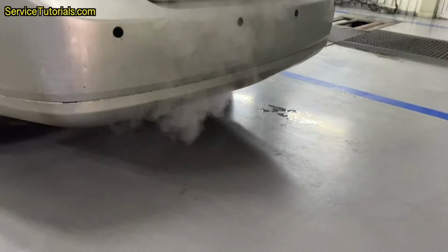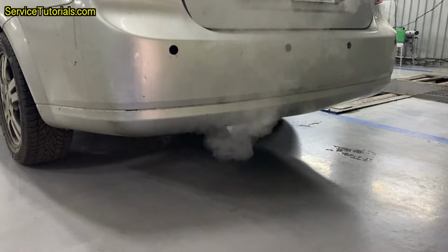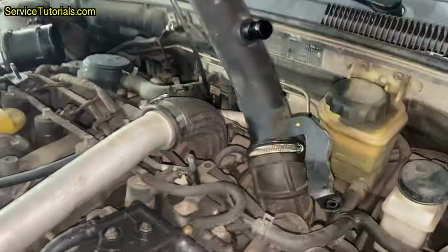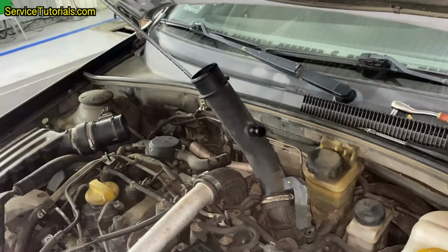You can already see that the car has started to take the white smoke out from the exhaust pipe. This means that the DPF cleaner has started to work, vaporizing all the hydrocarbons and removing the ash from the particle filter. The GerTechTeile DPF cleaning solution was used and tested in more than 1,300 car repair shops from Europe.